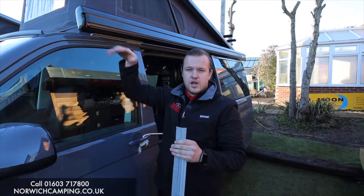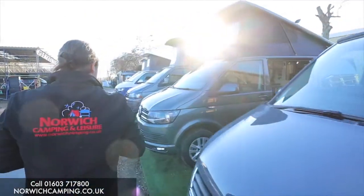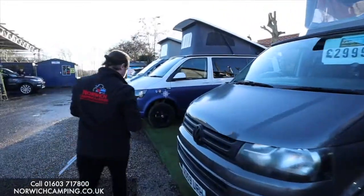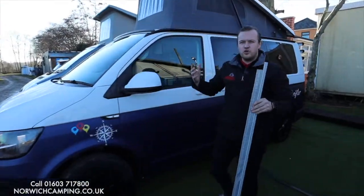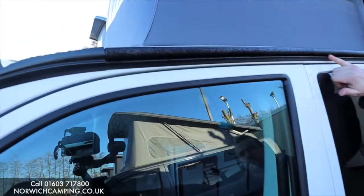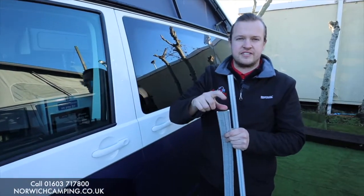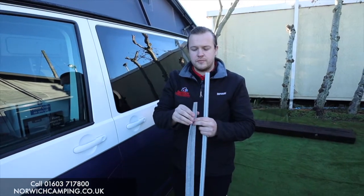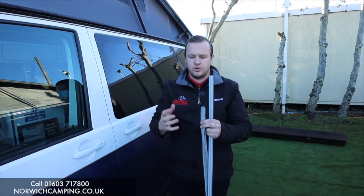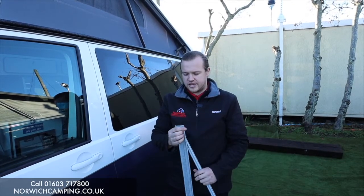When you want to drive away, you pull this out and the sleeve drops down. So that's a 4mm channel and a 6mm channel. You'll also have a Remo rail — down here on one of these campervans we've got a Remo rail. A normal awning rail is just like this one here, which has a standard 6mm channel. Sometimes when you buy them online they come as a twin beading with both 4mm and 6mm, so if you're not sure, that might be the best one to buy. Usually we'll ask you whether you need a 4mm or a 6mm so we know how you're connecting it.